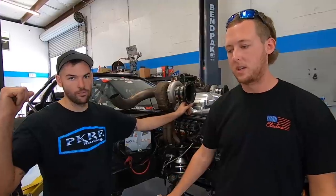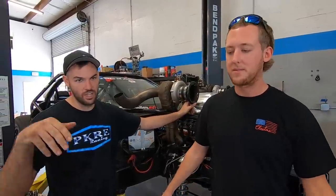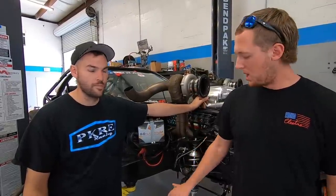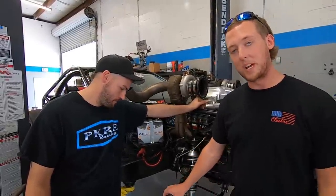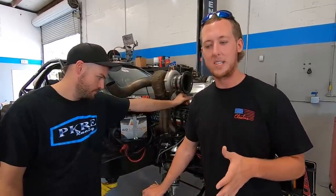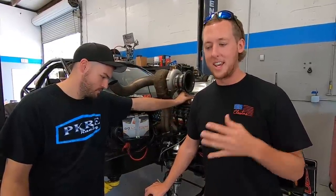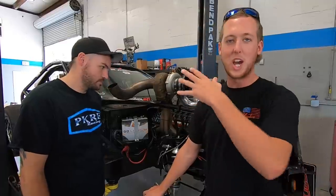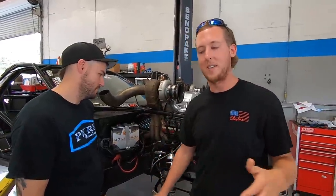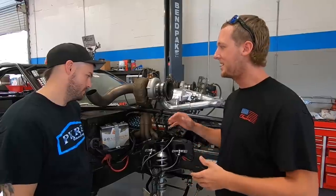If it's like 20 mph faster in the rear than the front, it'll take timing out to keep the tire spin down — kind of like a traction control, but not like a traditional one. So we've got a whole bunch of plans to figure this thing out and dial it in completely so we can start getting it down in the mid sevens where it should be. At that point I really do want to find a body for it, whether that's one giant body that fits over the top or a bunch of little pieces that help with aerodynamics — but the spirit of Leroy has always been how crazy he looks, so we'll have to keep that somehow.